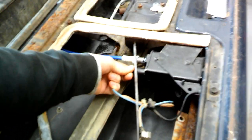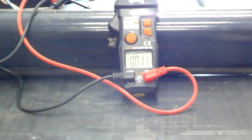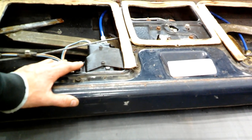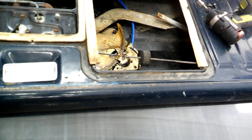It is going up, but I don't think I have a lot of juice to it. I heard it moving so I'll just see what kind of power I've got coming to this. I'm getting 12 volts - or 10.8 or something like that. The battery was pretty much shot, so I'll have to check the alternator, but I think that's the issue - just low voltage. I'll put this all back together and it should be fine now.